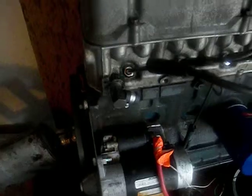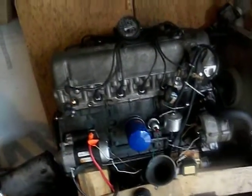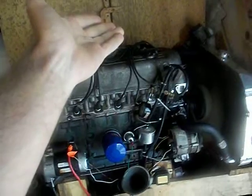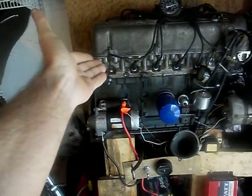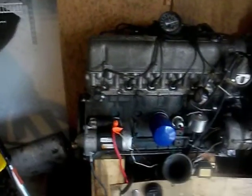As you can see, it's still running pretty rich. If you go through the EFI manual, it talks about there's an enrichment period going on here. First of all, the cold start valve probably fired, which keeps it a little bit rich — that only runs for a few seconds. So this is probably the residual effects of the temperature sensor. The water's cold, obviously, and the EFI's automatic cold enrichment.